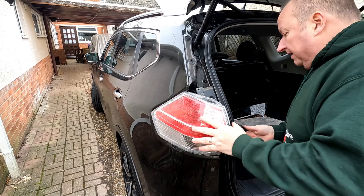Right, just got back. I took it down the car wash as well, so it's a lot cleaner than what it was. Let's just set you up there for a second. I've got the bulb, and also got some oil and also an oil filter. This is the filter it takes — just making sure that the rubber ring is in there for the oil filter seal. So that's the type of filter it takes on one of these. This is the 1.6 diesel engine by the way, and it takes about five and a half litres. It's a C4 — I think it's a low ash oil this one takes — and this is a 5W30, fully synthetic. So that's what we've got there.